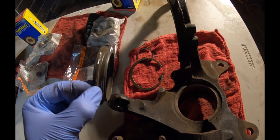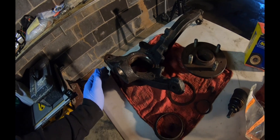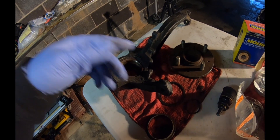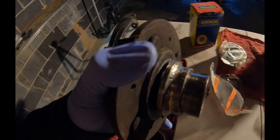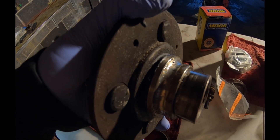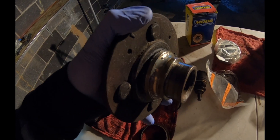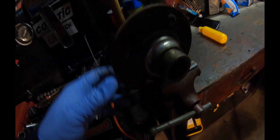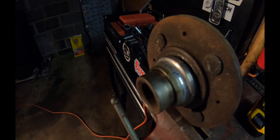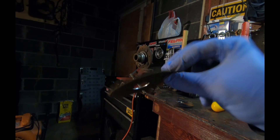You should also have a dust cover — that's basically the last thing going on. If these knuckles look a little funny, I did remove the big brake shield — the only way to remove that is by taking the bearing out. I will be reusing these hubs. The one problem I have is I need to grind this out — this is part of the old bearing that came off with the hub. I'm going to take a grinder, score it, and slowly work my way down to pry this ring off. I have a vice and a battery grinder — I'll cut right through the middle and this thing should pop right out.